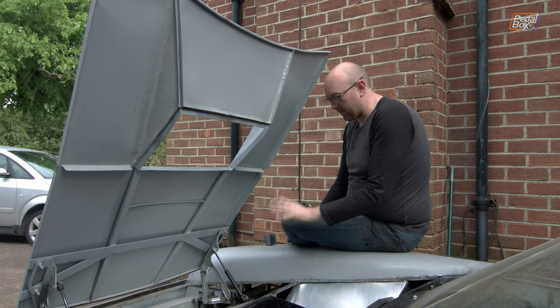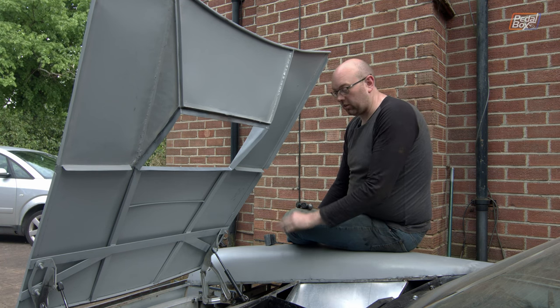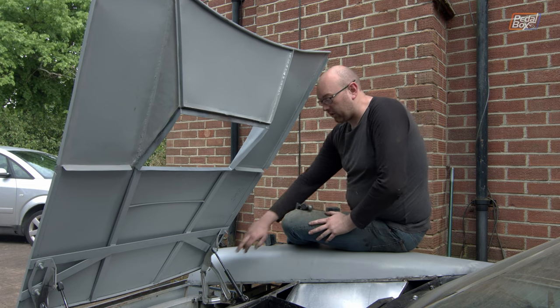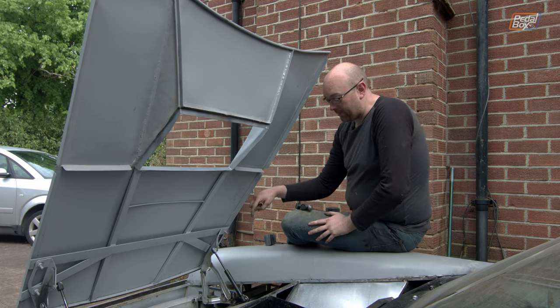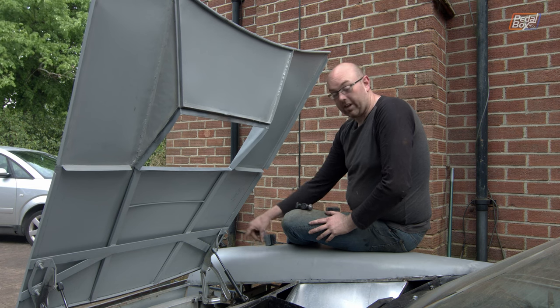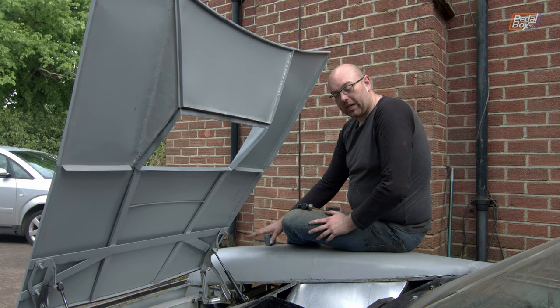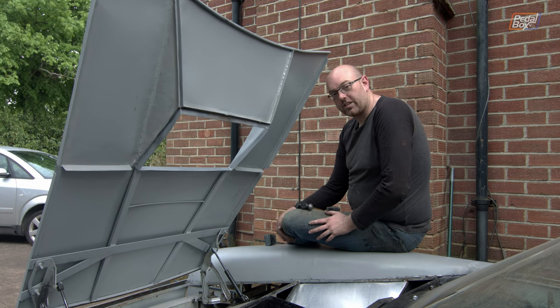The bonnet is looking reasonably good, but it's not the only thing we need to finish on it. After we cut the gas rams off the hinges, we've welded them back on again, and we haven't taken the hinges off the car yet, so they all need cleaning up as well. We're going to clean those and spray them because at the moment they're pretty rough welds going up the inside and outside of the piece that holds the gas ram on, and the little brackets on the headlight mounts all need fully welding in, cleaning up, and then painting.